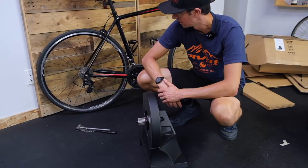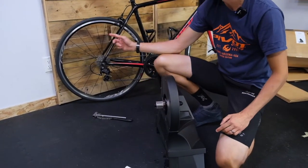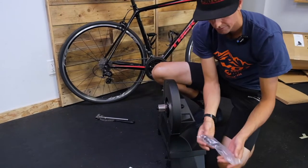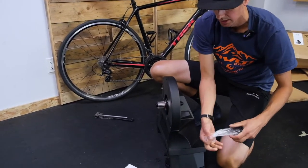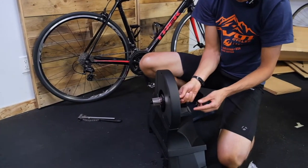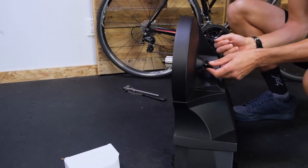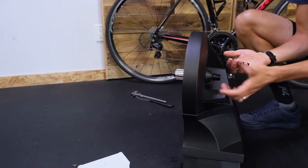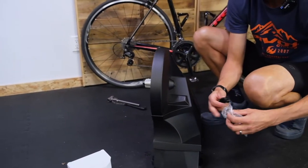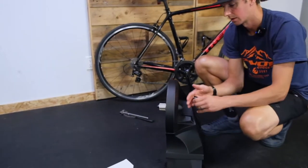The other detail that makes this a good trainer is that we have different end caps for different wheels. Jesse has a standard quick-release road setup, so we're going to leave these on. But if you have a disc brake bike, which a lot of people do these days, that is one of the reasons for these trainers — it is so much easier to get the disc brake setup going. We put different axle end caps by unthreading and threading on the correct end cap. You've got to go through the packaging and the instructions to figure out exactly which end caps you need. You can fit a mountain bike, a road disc, a gravel bike — pretty much any bike on these things, which is awesome.